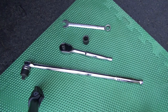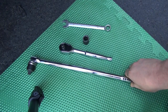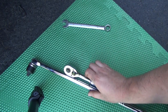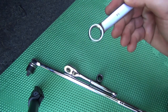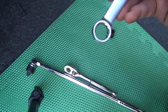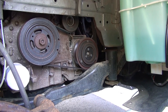So let's take a look at the tools we're going to need. You can use a breaker bar, which is just a large ratchet — it gives you a little bit more leverage and torque on whatever you're trying to remove or tighten. You can use a ratchet and a socket, number 14. Or if you don't have any of this stuff, you can use a 14 wrench. I would stay away from the multi-point end — see that end right there, it's multi-point versus a six-point; these tend to round off nuts and bolts. But if this is your only option, then that's what you've got to do.